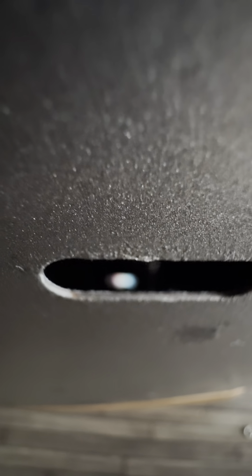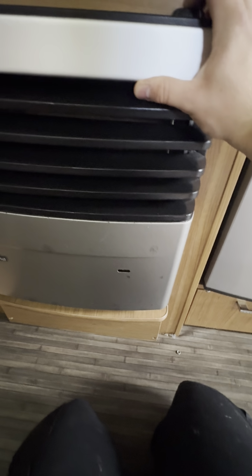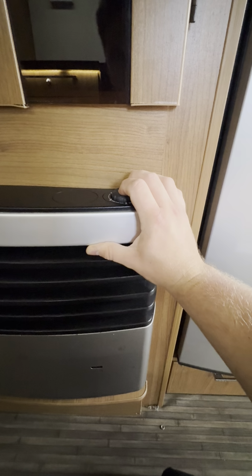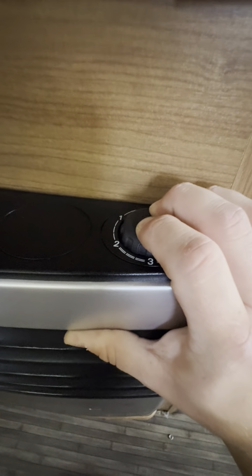And now it's just trying to stay lit because it's a bit cold, really. So because that's sort of going out, I'm now going to push back down again to get that nice, clean pilot flame to come back on. The reason I'm going to do that is because if the flame's showing me that it's not quite lighting up just yet, all it means is it's not quite warm enough to stay on. So pushing down and holding down on this little pilot flame here, just allowing that thermocouple to warm up a little bit. So I'm going to let go of it again now.